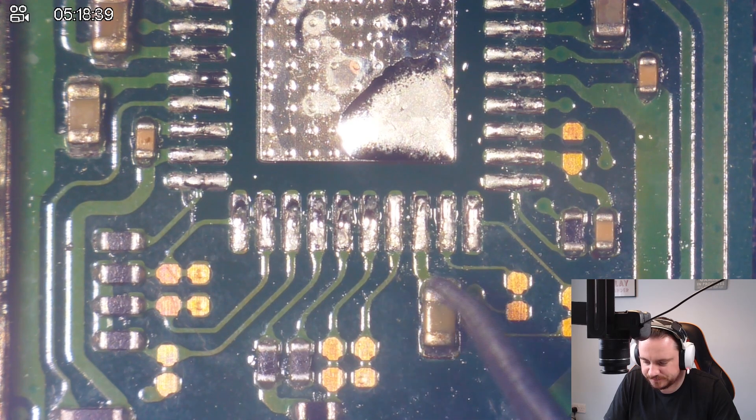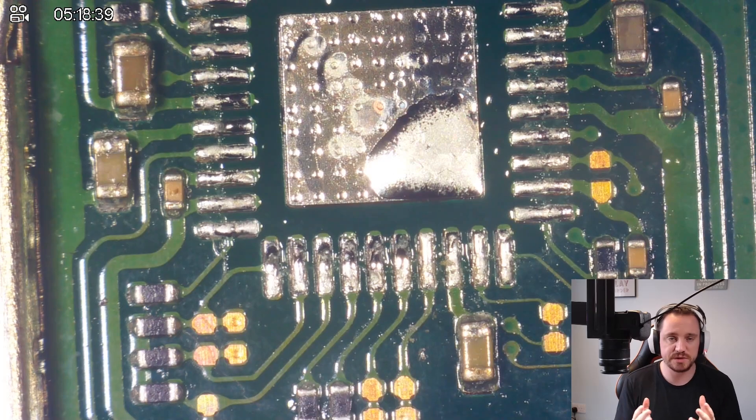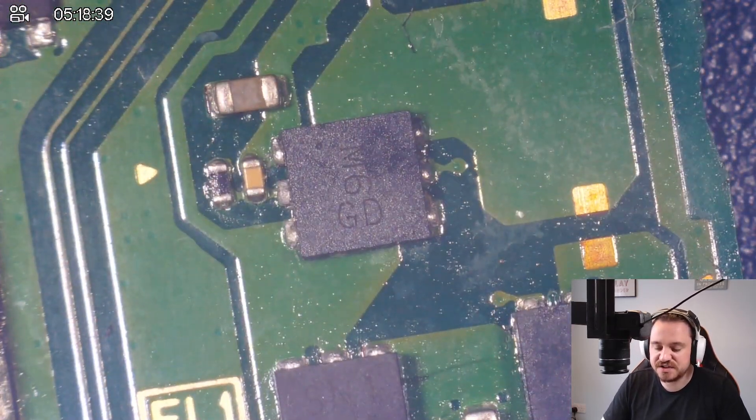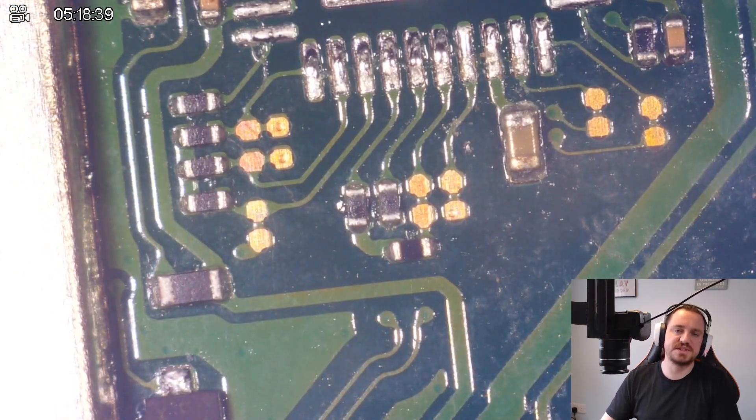My theory is that because we had a broken charging port on this Switch, the mangled port shorted and dispatched the CPU. I'm going to rule this one off as a dead CPU. If you have any advice as to why this might not be working and if there is a way back for it, that would be appreciated. I didn't know you'd still receive an amp draw to the battery if the CPU had died — so maybe the CPU isn't dead and maybe I'm just being an idiot. If you guys could let me know in the comments I'd greatly appreciate it. Sorry I wasn't able to fix this Nintendo Switch today — hope you have a good rest of your weekend and I'll see you in the next one.